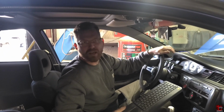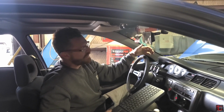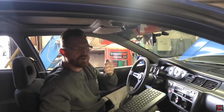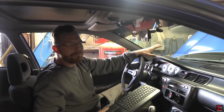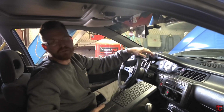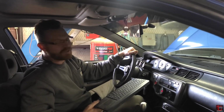Yeah. With the SuperTech setup, it's my favorite valve spring setup for sure. And I mean, if you get it right, it's nicer to have a rev limiter that you can bounce off of carelessly than have one that's so high that you don't want to be bouncing up there. It is when bad things are much more likely to happen. So the higher you rev, the more the tune has got to be perfect. All the other P's and Q's got to be minded.